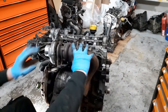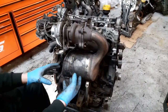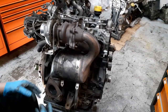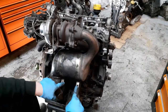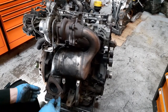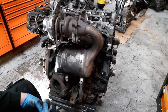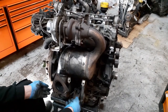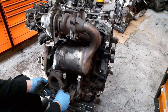Here's the turbo. That's the cat or the DPF, whatever you want to call it. Obviously with the newer 13-plates it hasn't got that — it's got a great big catalytic converter DPF down there. To start off with, there'll be a pair of straps going across the top here with a pair of 13mil bolts in it. Undo the 13mils. You've got 10mils holding the exhaust on — undo those three, pull the exhaust out the way, and that gives you a fair bit of room. If you want even more room, drop the drive shaft off at the driver's side, but it's not necessary.